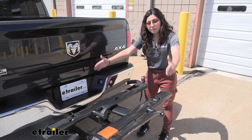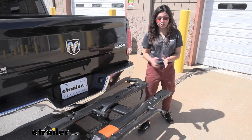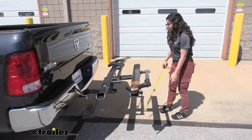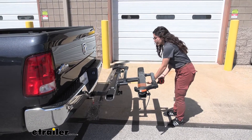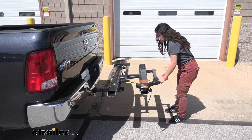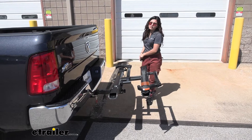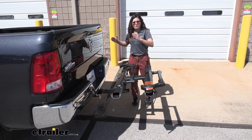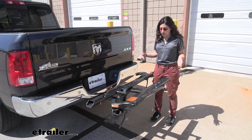When you have a bike rack like this on your vehicle, there is some length added to the back of your truck, so let's take some measurements. Measuring from our back bumper all the way to the end of the bike rack by the end of this hook, it's 33 and a half inches. That's a fair amount of length for a two bike rack — just something to keep in mind when you're backing into your garage or trying to park in a tight space with your truck.